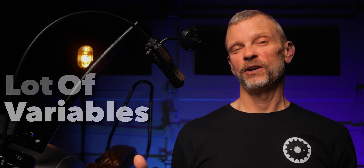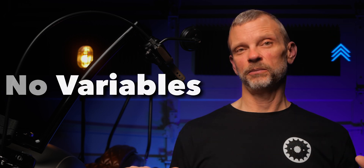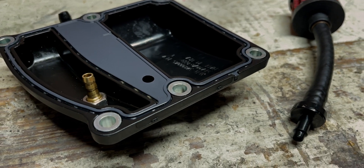So what does all of this mean for this vacuum ported catch can venting the crankcase? Well, there are an awful lot of variables involved, even more if you use the throttle body solution because you do have to put a damper in the line and figure out the right setting and make sure everything stays in balance. In contrast, the plain old original crankcase venting solution I did way back when has basically no variables — it has a check valve and a pod filter and it's super simple. The intake tube solution with this catch can is the closest to that plain old transmission top cover crankcase vent. So my decision after using this solution for a while is that I definitely prefer fewer variables, and because of that I'm going to switch back to the intake tube ported solution. I'm probably going to experiment with a check valve as well, and at some point I may just switch back to the plain old transmission top cover crankcase vent with the check valve and a pod filter because it works so well.